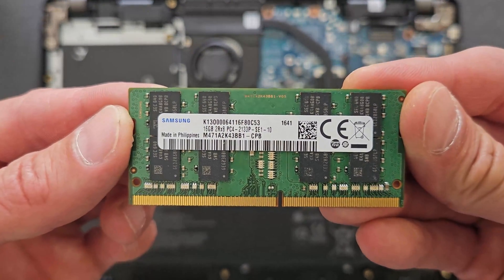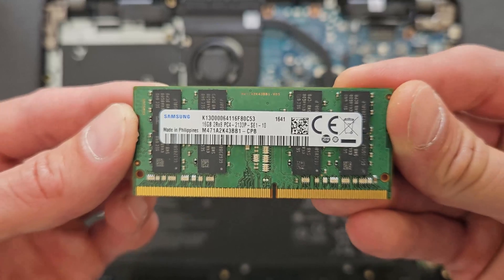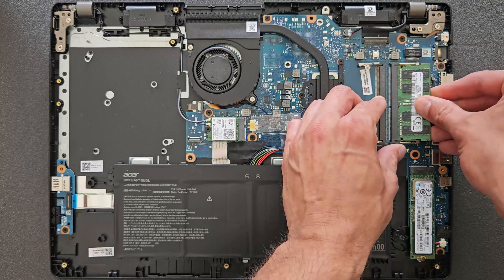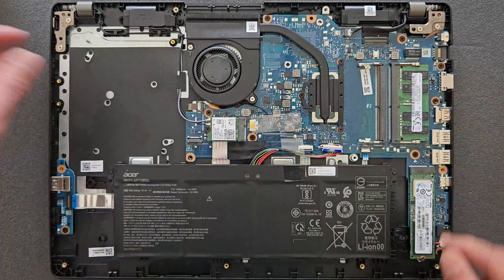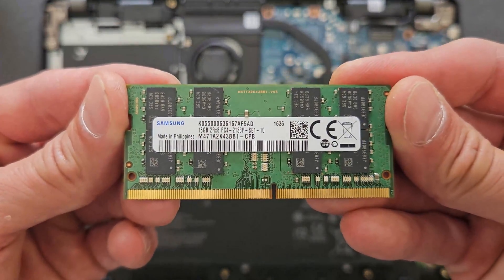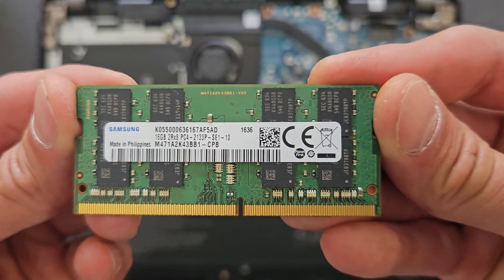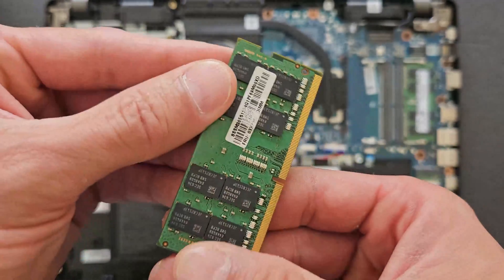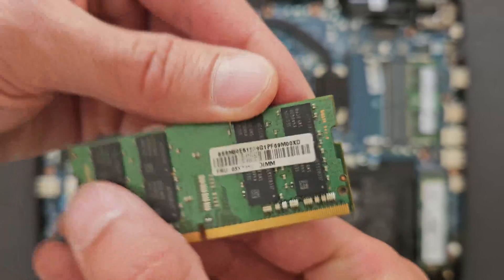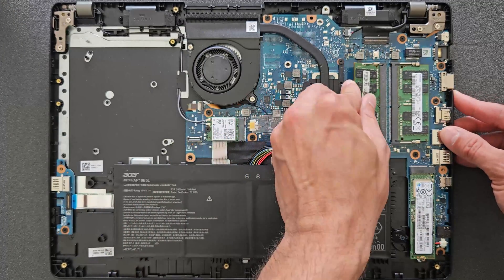What's going in now is a 16GB stick — lower speed but more RAM. I'm going to put 32GB in total: one 16GB stick now, and then a second one in a moment. So in total this laptop will have 32GB. Later we'll boot into Windows so you can actually see the specs and confirm that 32GB is working — I can personally say it's tested and working.